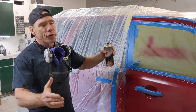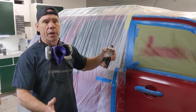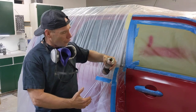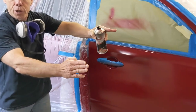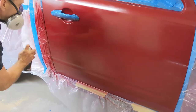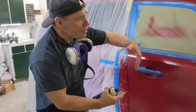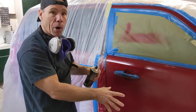Once you've got coverage, you want to kick that color out into your blend zone and use as much of the blend area as you need to get a nice smooth transition. Most automotive colors are not designed to be butt matches — they're designed to be blendable matches. So having that room to transition from your color to the color that's actually on the panel so you don't see the change is very important. We're going to flick the color out on the edge as we finish each pass. That allows the metallic or pearl to lay out, and the wet bed from the S1918 helps it stick so you get a nice even transition without any sparkling or mottling on the edge.